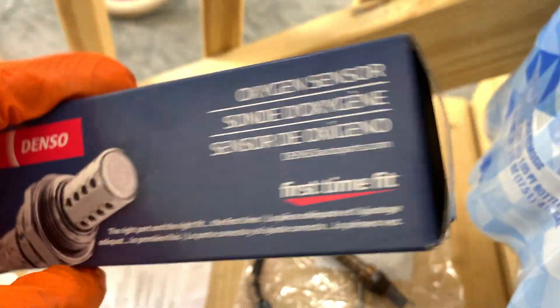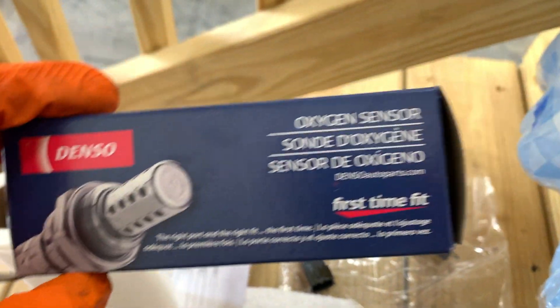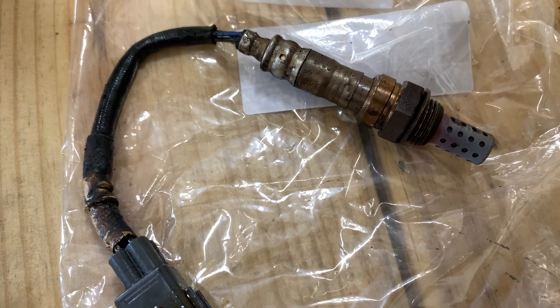Make sure that your electrical connection is also disconnected. Once you start unscrewing that O2 sensor it will come out that much easier. I'm replacing it with a Denso — there is the part number right there, it was about $35 off of Rock Auto.